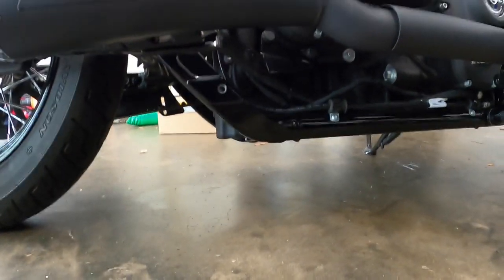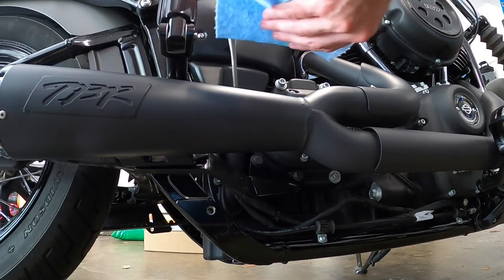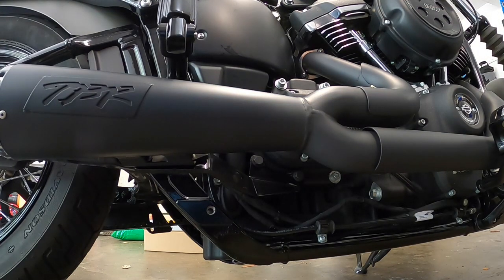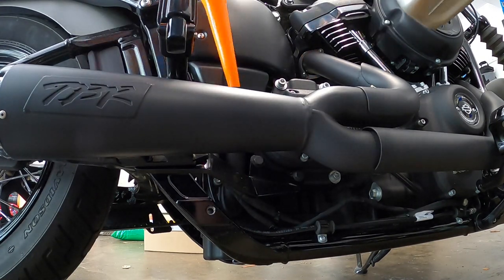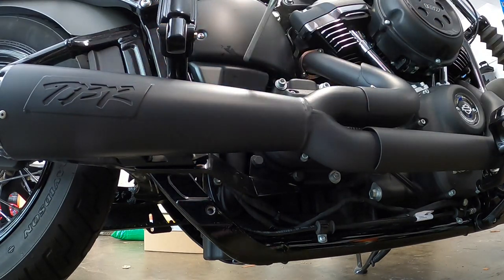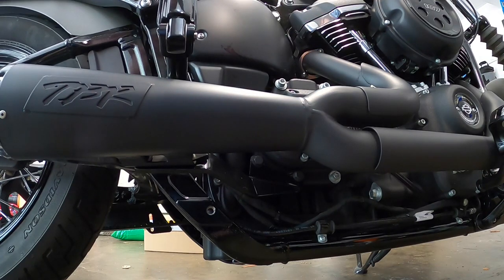After running it, the oil level is just barely on the tip of the dipstick — just barely touching the tip. You probably can't really see it, but with it just touching the tip it says to add a quart. We'll go ahead and add about three quarters of this quart — it's the last quart I have — and see where we sit. The exhaust is hot. We're about halfway up, so go ahead and add the full quart. We should be good. They give you five quarts at the dealer, so we'll add the rest.